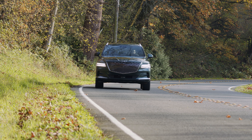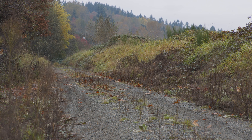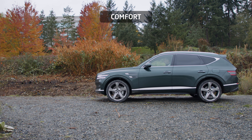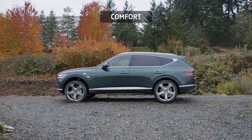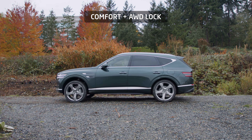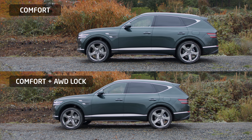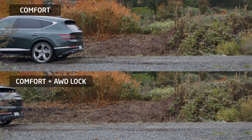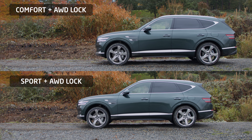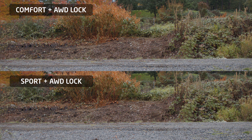First, let's see how the various drive modes respond to our standard slow-motion gravel slip test. The GV80 is based on a rear-wheel drive platform with an all-wheel drive system that sends power to the front when needed through a central clutch. In the comfort setting, the system throws a surprising amount of gravel from the front wheels once it's out of the gate. With all-wheel drive lock engaged, we get a little more spin on the front wheels, and if we put the results side by side, you can see it's much faster out of the gate on a loose surface. You might think switching to sport will make it quicker still, but with the AWD lock button engaged, we get an identical result compared to comfort on this surface.